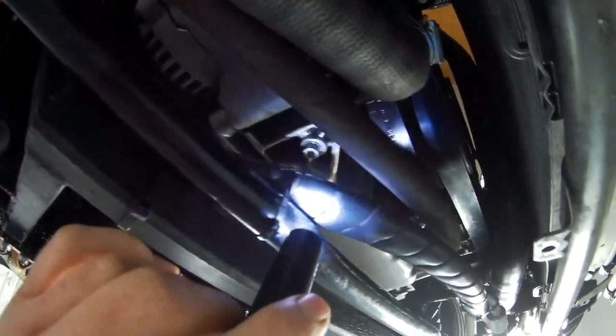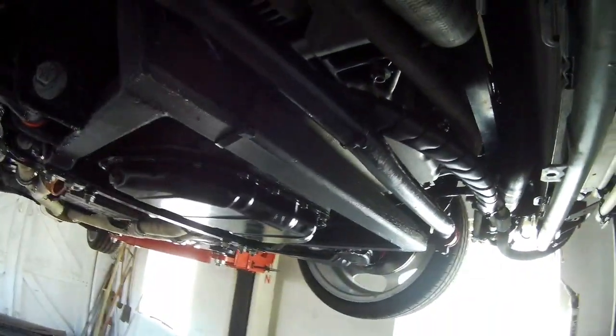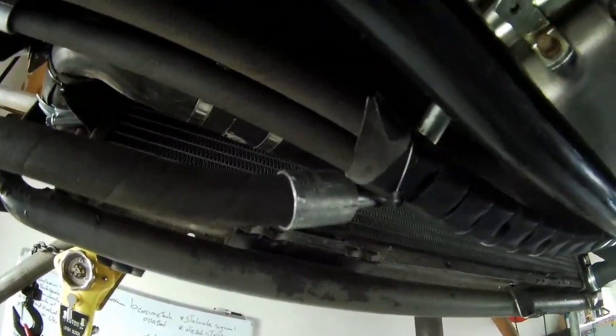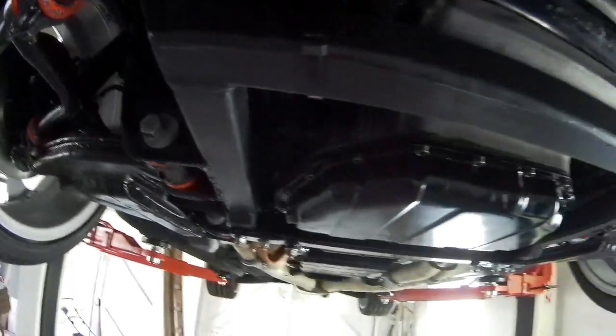So yeah, this one is connected to the oil cooler, also filled up completely, the other one also. So everything has enough play. I did some wrapping already, it's not completely strapped, but it's enough to keep the hoses from shifting around over pipes or anything else. I always do it like this, also with a small piece of rubber in it, so you don't get any cuts in your hoses. Also here you can see, it keeps the hoses from rubbing and moving against something.